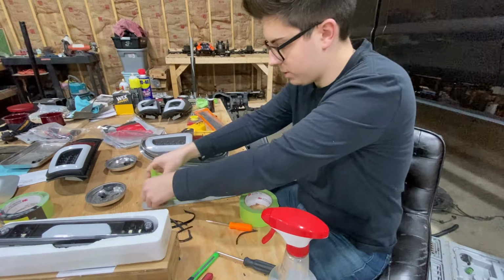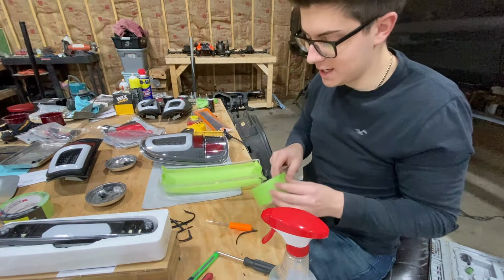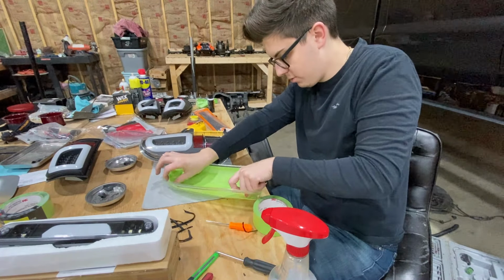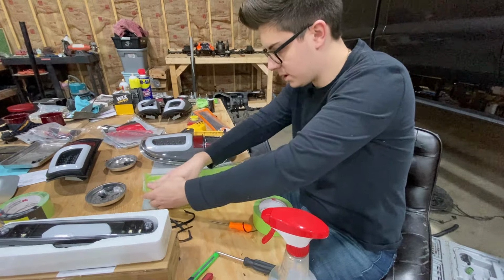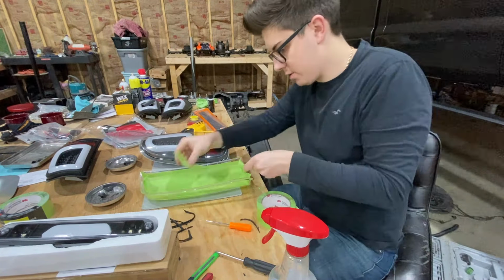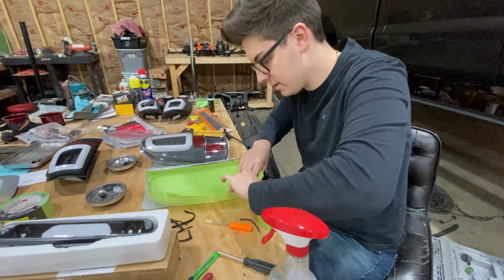So if you've watched one of my older videos, I used to actually put the taillights back together and then I would paint the border. So I actually don't do that anymore. I just found that it was easier and quicker, less cleanup, saves the customer money, saves me time, makes me more money if I just go ahead and tape off the inside of this lens.